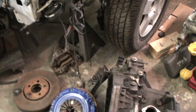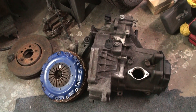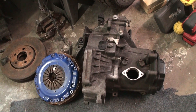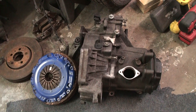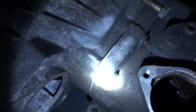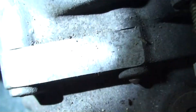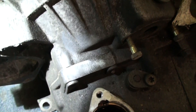A lot of this stuff will work from '93 on. This is an older-style CCM-type transmission — it came out of like a '93 to '99 Golf or Jetta, and some Passats also had the VR6. You want to come down and read that code on the transmission. This one is a CCM, and CCM is definitely a VR6 transmission — that's what you need to look for.